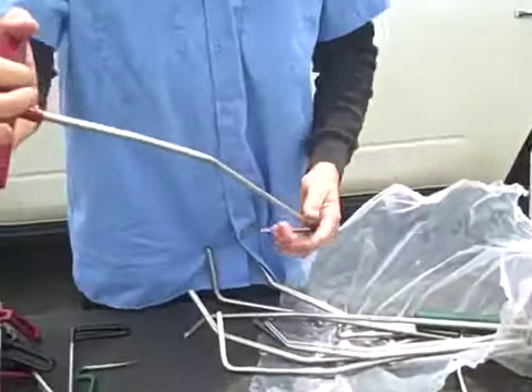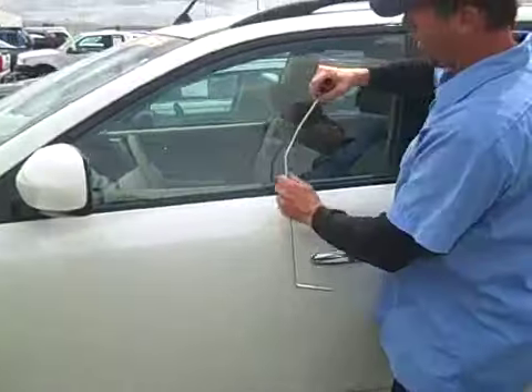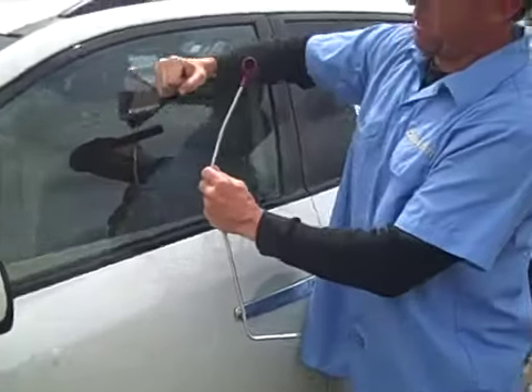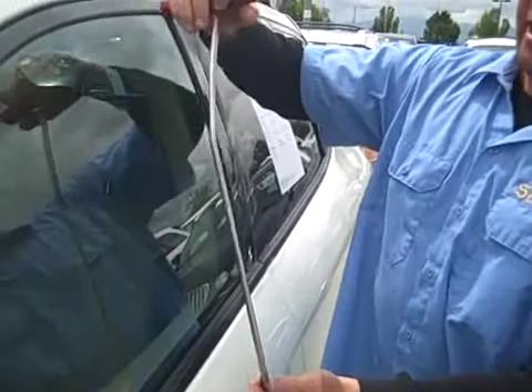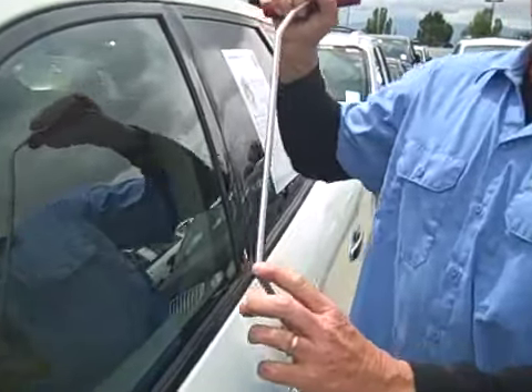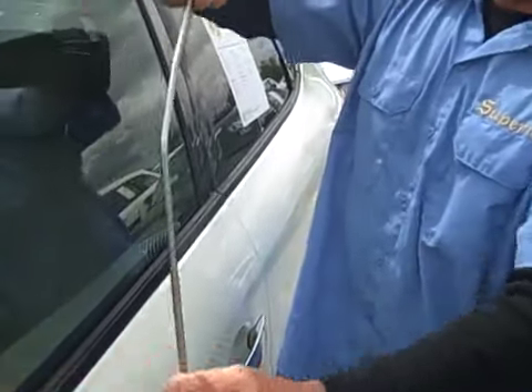Here's one of our window tools. You'll notice it's got a double kick right here, so when you're going down the glass, the tool — like most other tool companies' tools — is straight, and that'll hit the glass. Even if the glass goes down halfway, you don't have to worry with this because it's bent. It gives you more leverage for twisting, and you've got the hockey-style tip at the tip going down into the door for twisting out your dents and for glass access on the doors.